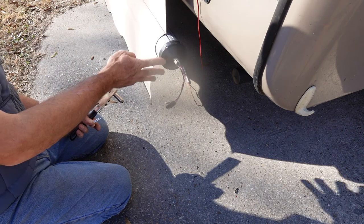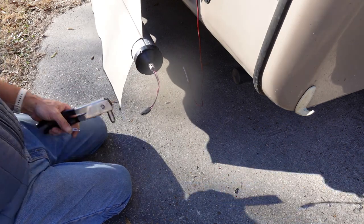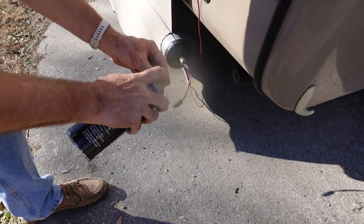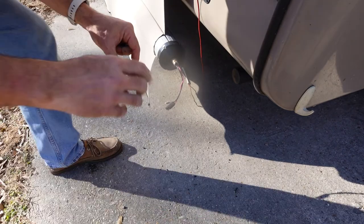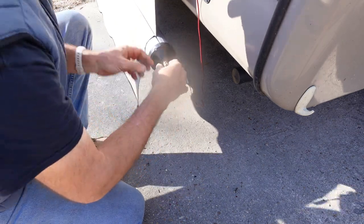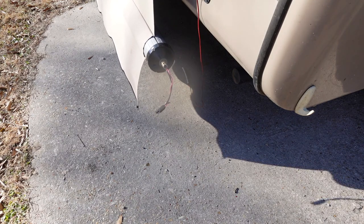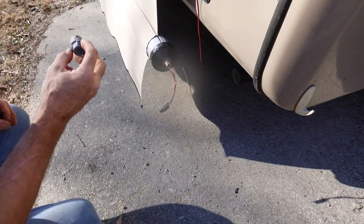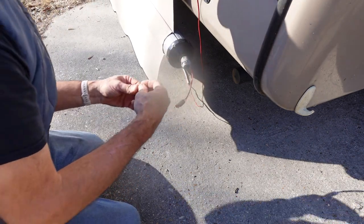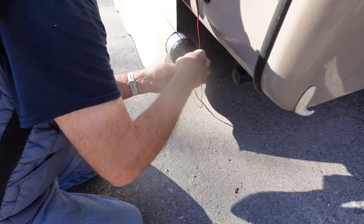Spray it in there. Put the bushing back on. Put the E-clip back on. Put the pin thing back in. And then we can bolt the cover back on. Go get the lube. I'll be right back. This baby, marks line up. She goes on about like that.